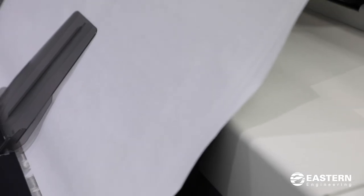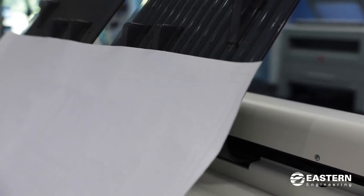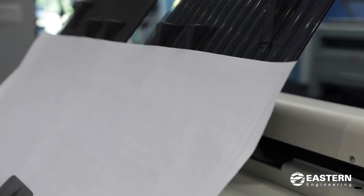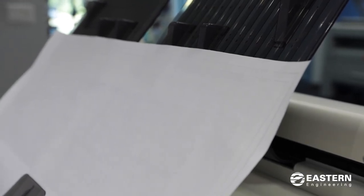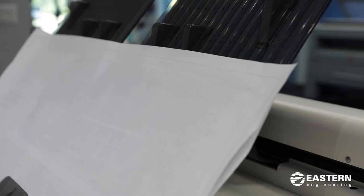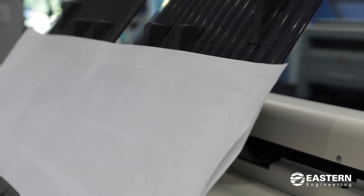The prints will come out on the back of the printer and up these plastic trays. It will hold around 55 to 75 prints and will alert you when the stacker is full, pausing printing temporarily until you unload the stacker. You also want to keep the printer away from the wall in the back — around two feet — to give clearance for people to get around the back to clear jams and also for airflow.